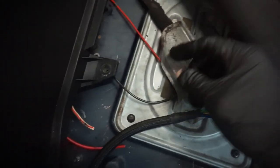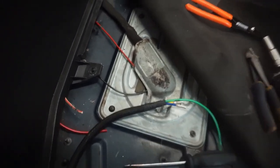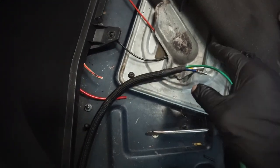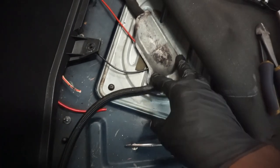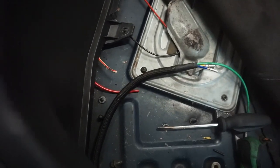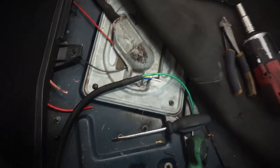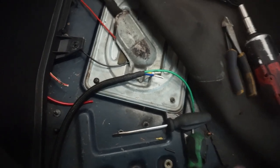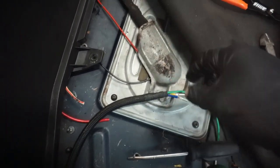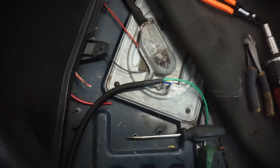So with the wiring, it's run through the factory plug. If you peel the tape back through that boot, you can actually run both of these wires. I don't have any more, but I always put a 2-pin connector on the other end of this so that when and if for whatever reason you need to service your fuel pump, it's just one connector in the back. You unplug it and it just comes off as if it were stock. The primary connector that goes to the hanger is now just for our fuel level and our fuel low light. You would unplug that, take the little ground off, and then there's one extra 2-pin connector, which will go on the other end of this, and then the whole thing comes out just like factory.